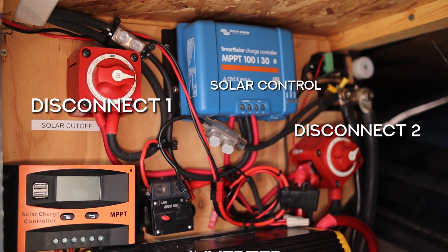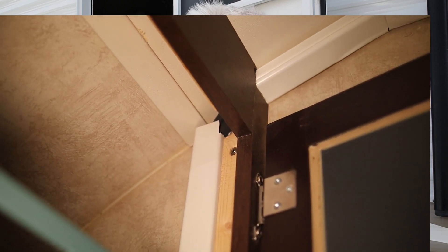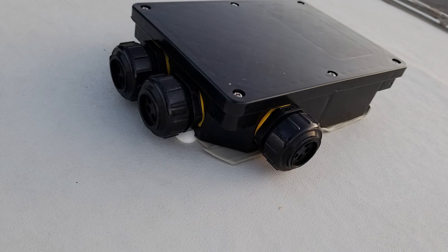Once I have all my connections inside — my disconnects, my solar charge controller, my inverter, and some other gear — I had to get the wiring up to the solar panels. My camper is not set up for solar panel installation so I had to come up with a plan. I couldn't fish the two gauge wires from inside the storage bay up to the roof completely buried in the walls, so I drilled some holes into the cupboard and used raceway where I wanted to come out onto the roof. I removed the light fixture and used a small drill to make a pilot hole on top so I knew where I'd end up. I positioned my combiner box right on top of that hole so the cables fit right inside.